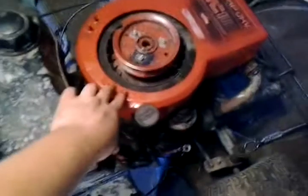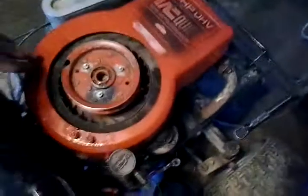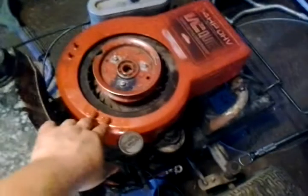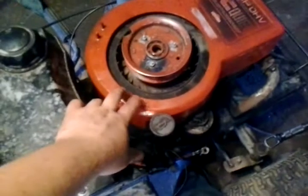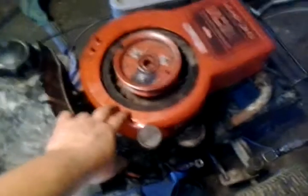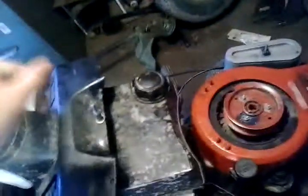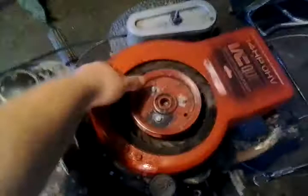I have welded on two sets of bolts for the catch can — two here and two here. I thought I could do it like a certain guy on YouTube did; I'll link that video in the description. But the only problem is the clearance with the gas tank. You might say I could move the gas tank back, but the problem is it would intercollide with the steering column shaft. So instead of doing that, I just welded two new bolts over here.